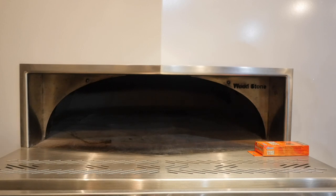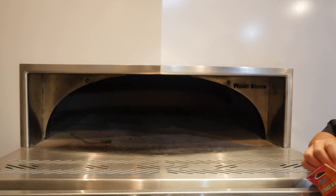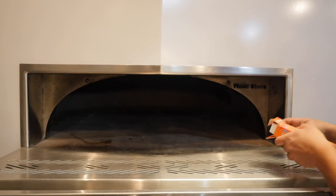The first thing we're going to show you is the initial startup procedure. This is your oven being fired up for the very first time. We're assuming it's been properly installed and your ventilation is all hooked up and turned on. The first thing we want to do is slowly heat the oven. All of our ovens are cured in-house at the factory, but it's possible the oven has absorbed a little moisture during shipping and installation. So before firing it up for cooking, we want to slowly heat the oven to push out that moisture from the insulation and ceramic.